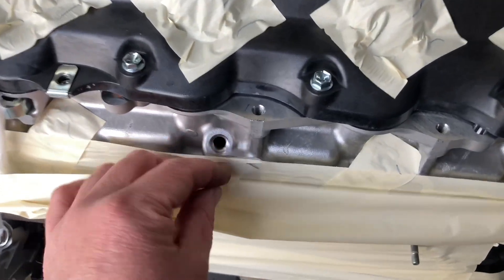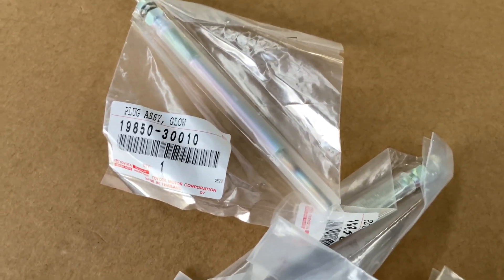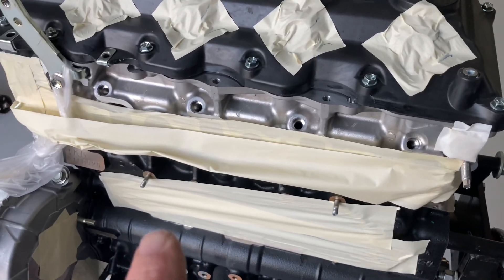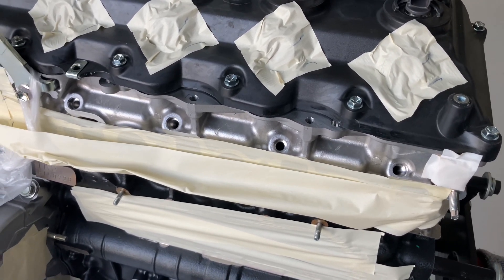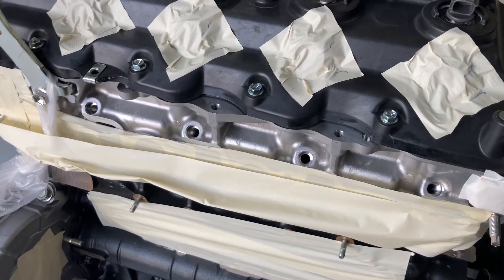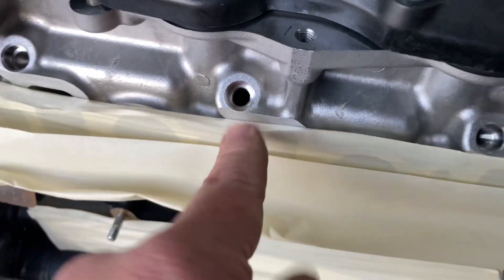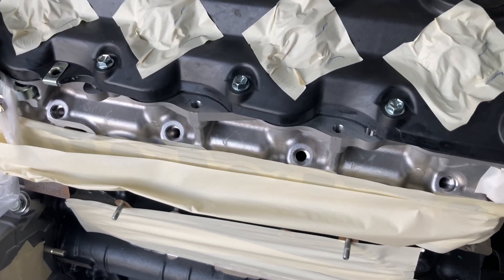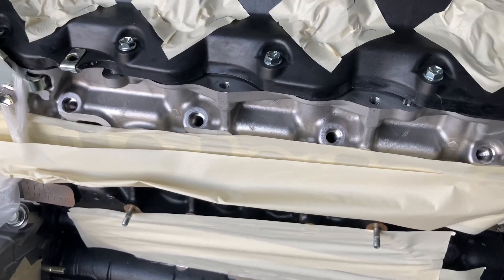One of the most important options when fitting a new engine — new glow plugs. Do you want the old ones from your old engine, which are probably fine, or do you spend another couple hundred bucks on new ones? A new engine doesn't come with glow plugs, so it's definitely an option to put in your old ones. If they're 10 or 15 years old I'd be putting new ones in. The risk with removing old glow plugs is that alloy from the head can come out stuck on them, costing extra in labour. So new ones are wise but not mandatory.